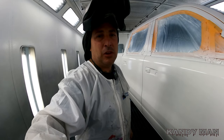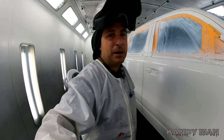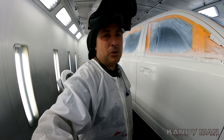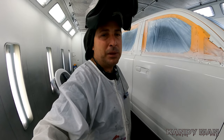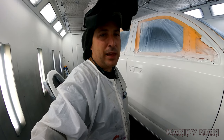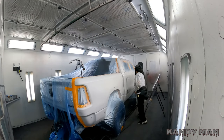So sometimes, each job is different. You gotta do it the way the job, you know, needs it. So this job doesn't need me to milk out my blend. If I was doing it in the middle of a door, I would do the milk on the blend, but I'm not gonna do that. And that milking I'm talking about is called diluting, guys. I had a guy ask me what I mean by that. You dilute the base with the base clear, and that's in my last video on that one I sprayed with the 3M performance gun, so check that out if anybody's new to the channel. So let's continue with this job.